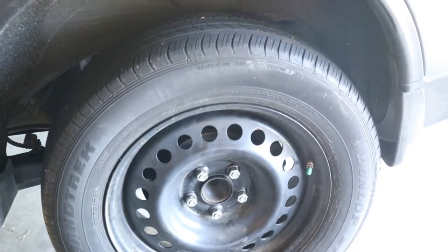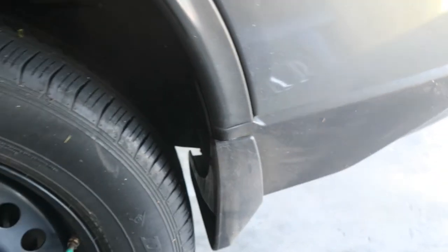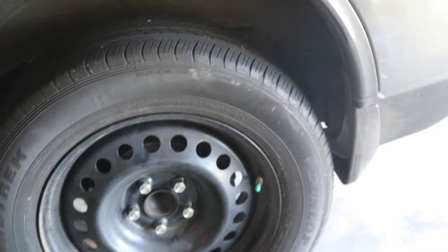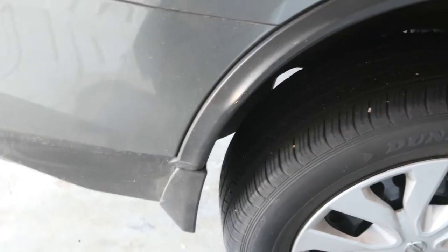The problem is the rear tire will move back a little bit to the back. Right here the gap is about one inch and it should be about two inches. I'm going to show you the other side so you can see. As you can see from here, there's a gap between the fender and the wheel and the tire itself, but on the other side it moved back a little bit. So I'll be changing the lower control arm on this vehicle.